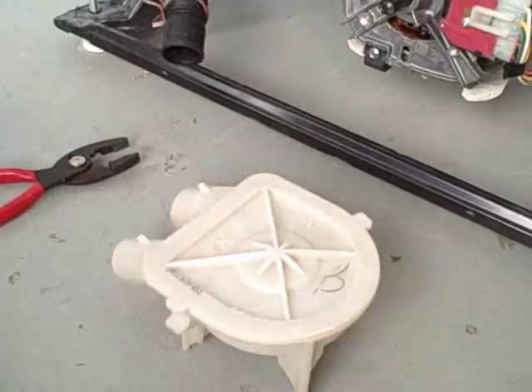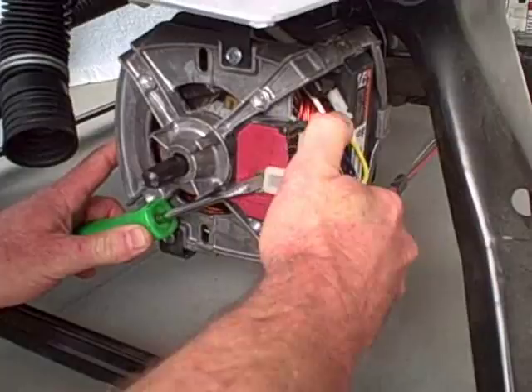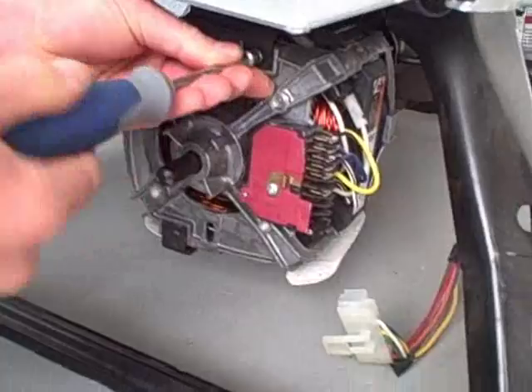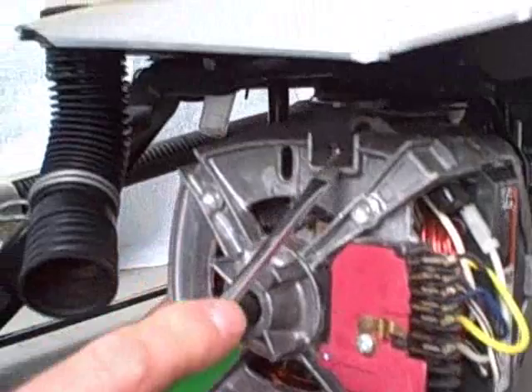And there you have your pump removed. To remove the motor, place the screwdriver under the clip, pry away from the motor and remove the electrical connection. Then take a quarter inch nut driver and remove the screws from the clips that hold the motor in place. Once this is done, take that flat head screwdriver and pry the clip away from the motor. Then put your hand under the motor and do the same for the top clip and the motor falls into your hands.